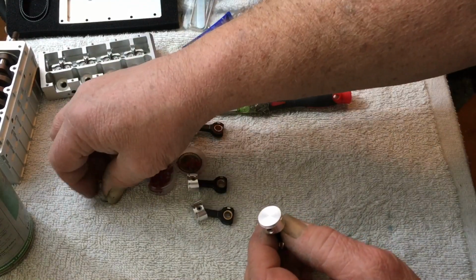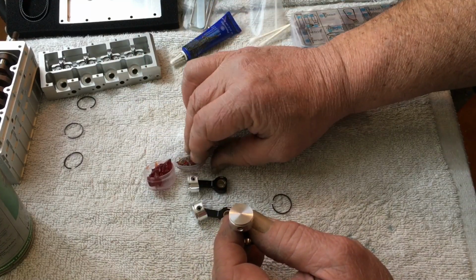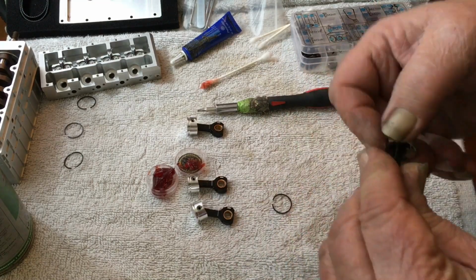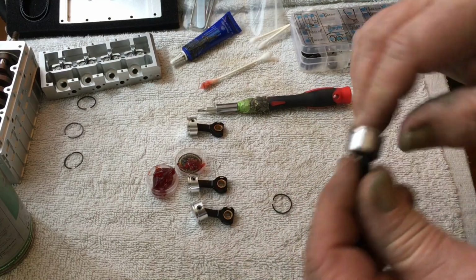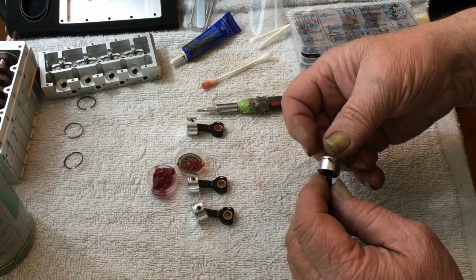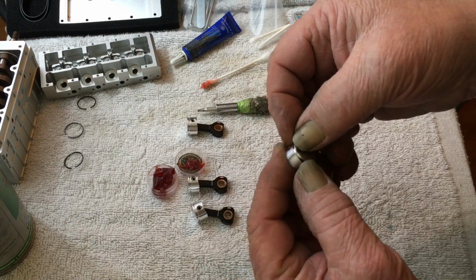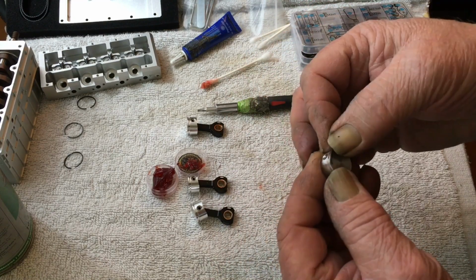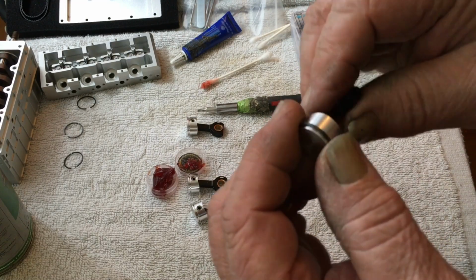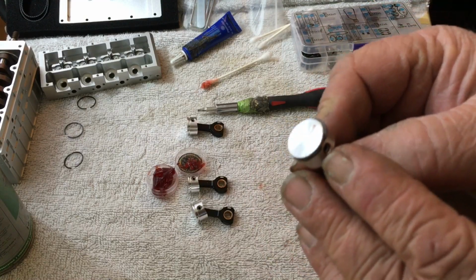So here's ring number 1. I'll probably do this by hand with some grease because I want to make sure you grease the whole piston up, okay? The fuel will wash the stuff out. Now you get one little leg down there in the hole and then just walk it around. And then when it's in, make sure you turn it a couple of times, okay?